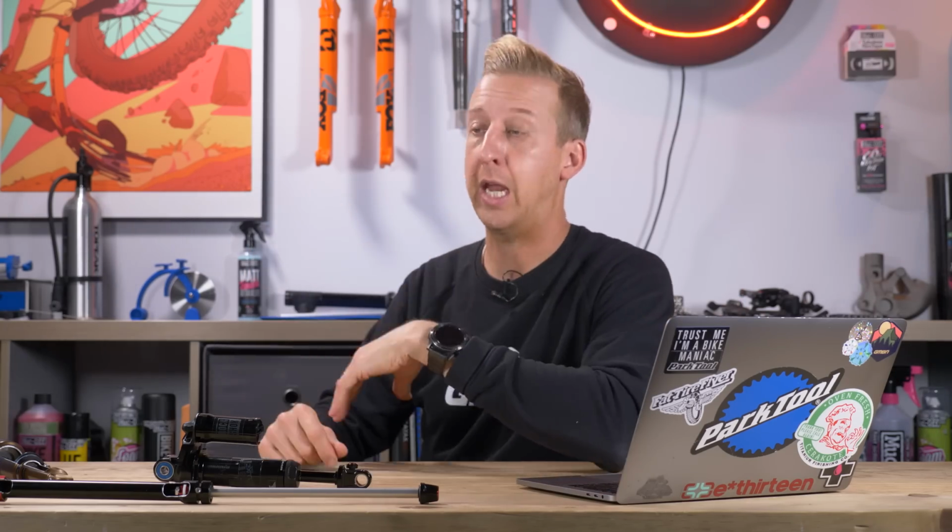I would say it's probably less about the intention of the riding and more about the way the designer has wanted the bike to perform. So on a bike, it's not just a case of, we're going to build a bike that has a progressive feeling back end. It's more a case of, we want to build a bike that has no anti-squat and no anti-rise, but has chainstays of this length, that has a 4-bar linkage, and we want to mount the shock vertically, and so on.